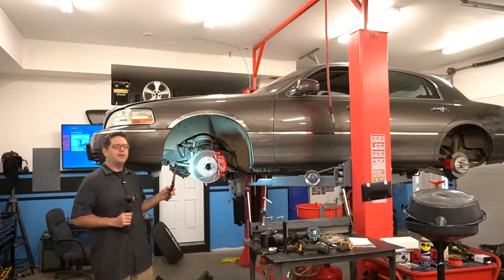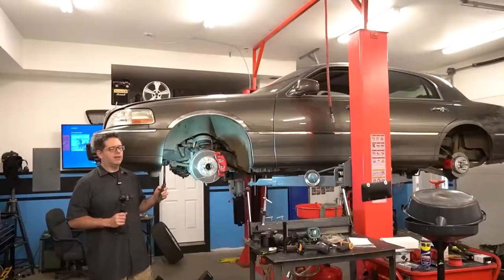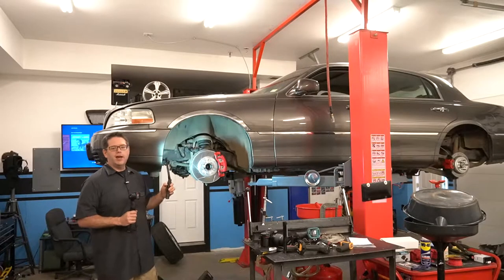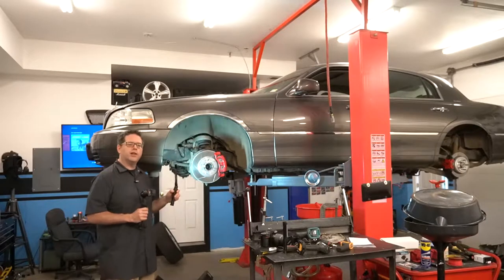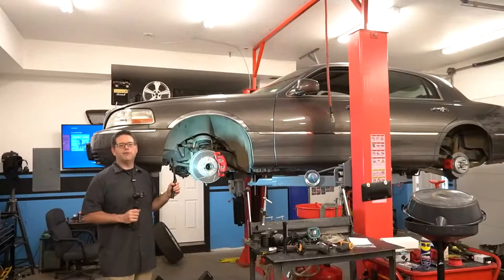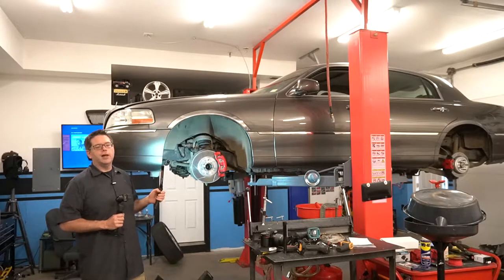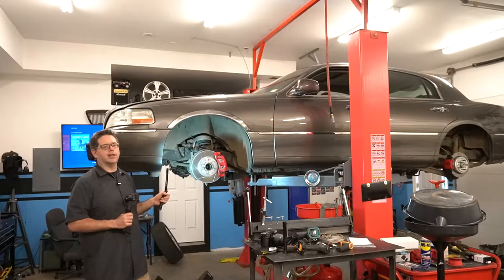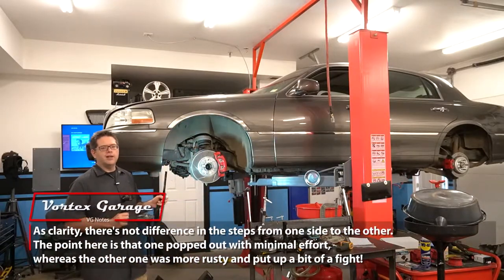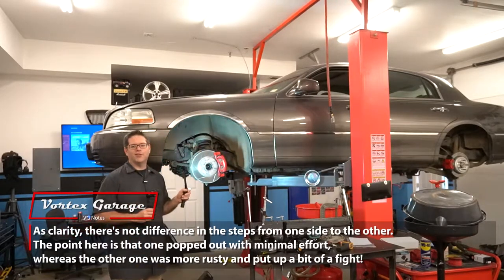When it came to getting those bearings out, this side was actually really simple. The other side — the bearing was a little rusty on the back and very difficult to get out of the knuckle. It took a lot of prying and pulling, and even using some tricks — I'll call out another channel, South Main Auto, which has a lot of good tricks for getting bearings out of knuckles. I've already tossed them out but I'll show photos from the job. This one came out so easily I thought there was nothing to it, but on the other side I ended up having to use a slide hammer and a few other tricks. It was even worse than the WJs where the reverse bolt method usually gets you what you need. The passenger side was really difficult — this side really simple — and of course I did the easy one first, then it took two hours to get the other side out.